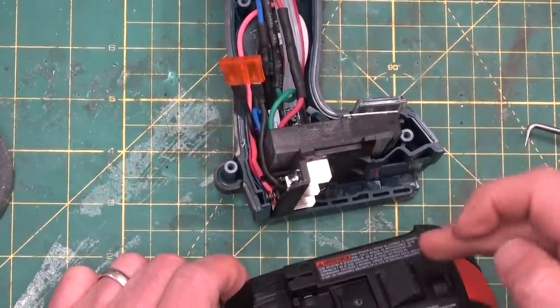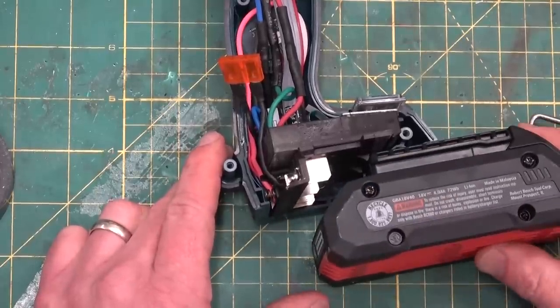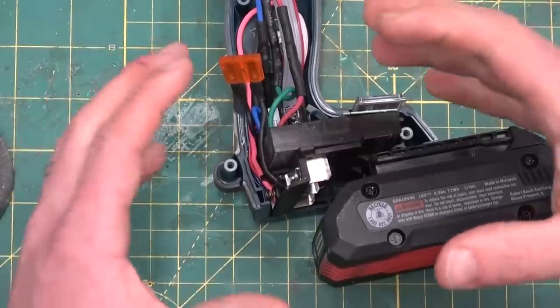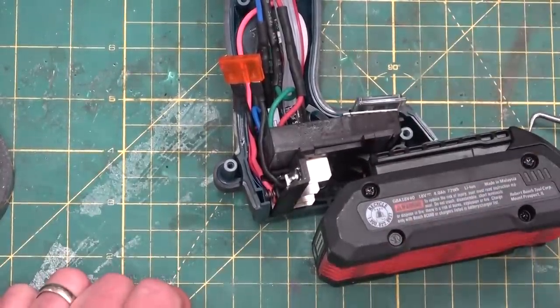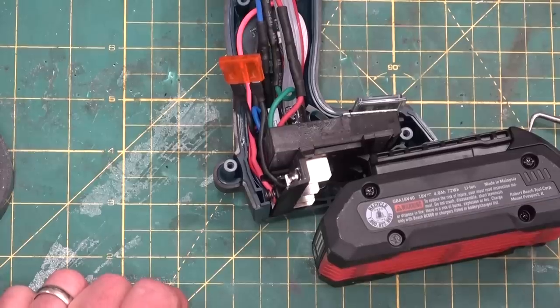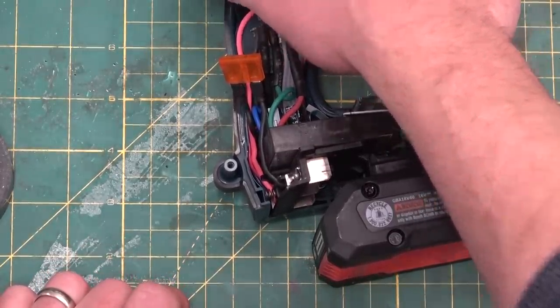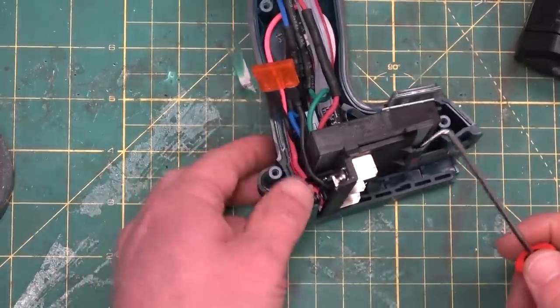One thing I didn't tell you was it's a double action latch. So you can latch it at the one step and the battery is engaged in the tool. It's all one piece together, but electrically it's not connected. So then you can throw it in a bag or a bucket or a service truck or whatever, and you don't have to worry about killing the battery or having the thing spin while you're driving down the road.